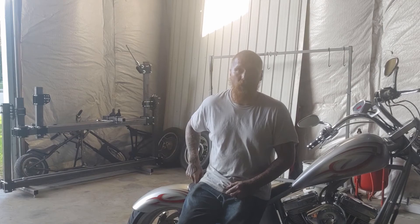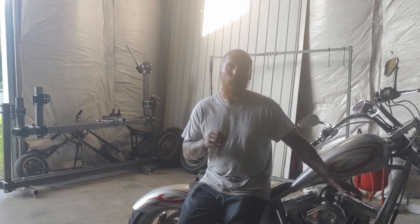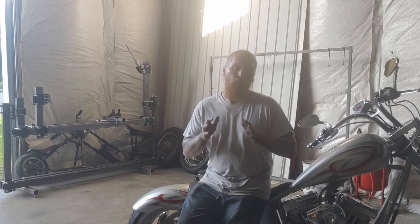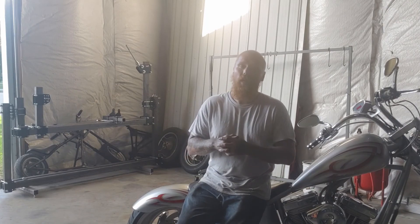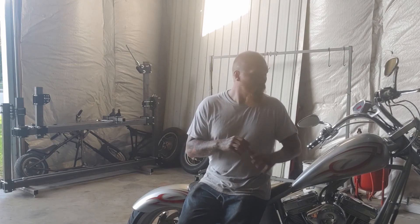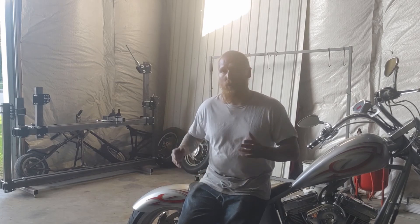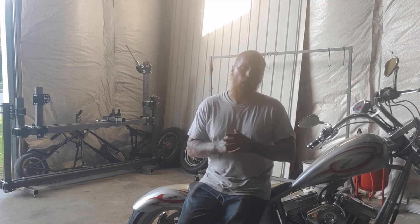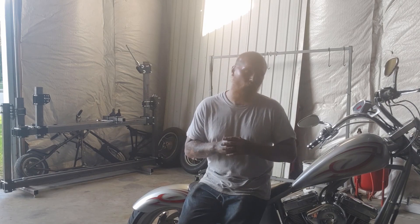I also think the battery needs to be replaced on this particular bike. With these tests, we know this regulator rectifier isn't doing what it's supposed to do — because if you go back to the beginning of the video, we had about 14.2 volts on our off-idle test, but after the bike got a little warmer and sat for a day, we didn't even break 14 volts, which isn't enough to maintain the battery while going down the road. I hope you enjoyed the video — if you did, like and subscribe.